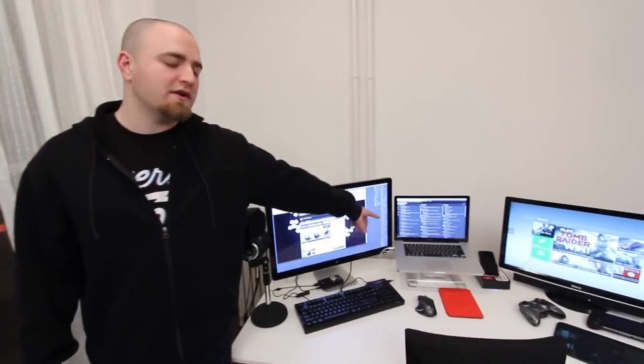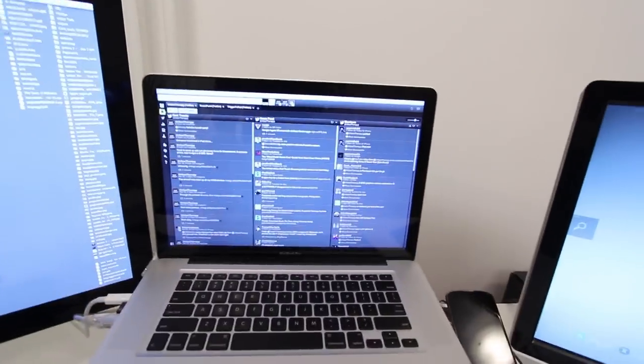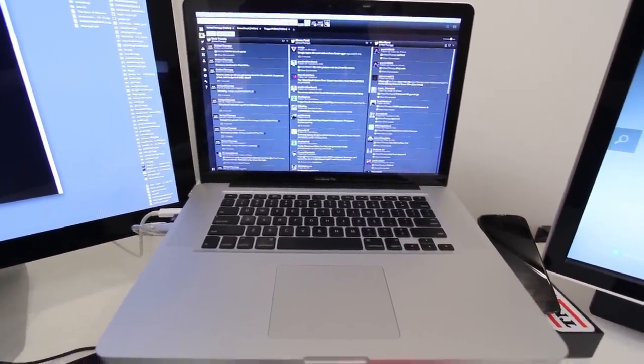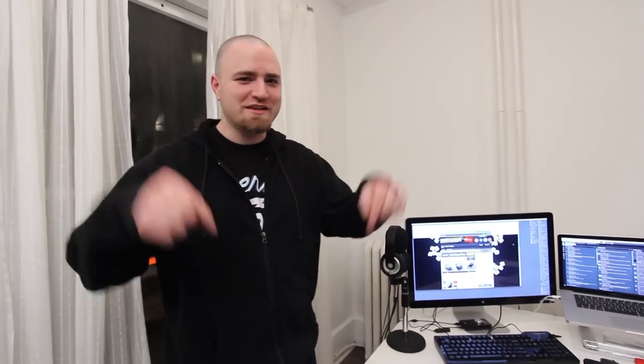I've also got my MacBook Pro over here — that's at the heart of the entire setup, still my main laptop today. This is a late 2011 model, but I did so many upgrades to it and customized it in so many ways that I just didn't want to say goodbye. I replaced the optical drive with a hard drive and also replaced the traditional hard drive with an SSD. You can see the entire operation in a video — I'll link that in the description. It's my trusty 15-inch MacBook Pro — a quad core — fairly snappy when it comes to video work.